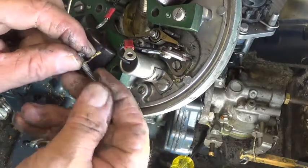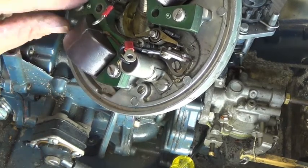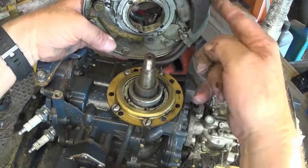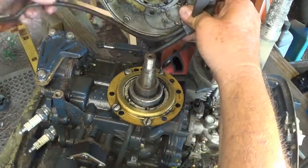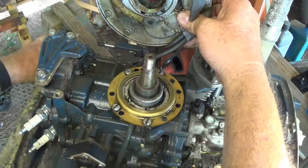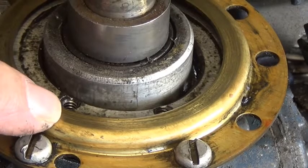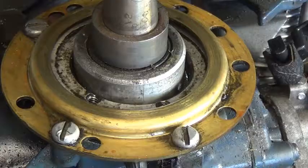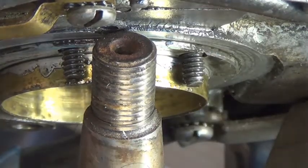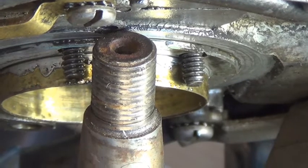We did the other side the same way as this side. The short one here coming right out of this coil, right close back by the carburetor — if you follow that, here's the one labeled 'top.' And then the other one is obviously the bottom cylinder. As you can see, this ring is where this bolts down. What I did is I ran this screw and this screw down from the top and I'm going to try to line them up and catch the thread on this. I think if you get one side, you'll be able to get the other — that's my plan.